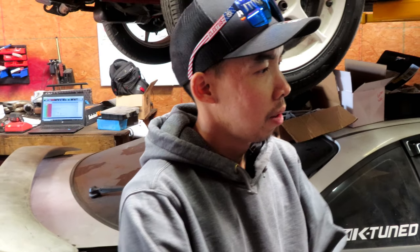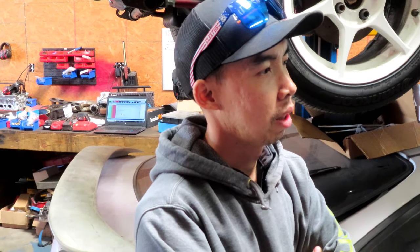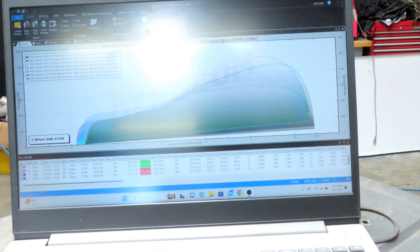What's up guys! Just got back from driving through Kissimmee, which was a bunch of fun. Looks like we made some power with the RSX. 503 horsepower, right at 13 pounds of boost. That's crazy! Is this on E? Yes it's on E — that's why. Threw a little bit more timing at it and it picked up a lot. Heck yeah — 500 horsepower with only 13 pounds of boost. We don't know what the clutch will handle, so we'll either stay here or turn it up some more. Dude, 500 for a street car — this thing is going to be walking on 90% of everything on the road. Nice smooth power build, stays consistent and picks up. Super awesome.